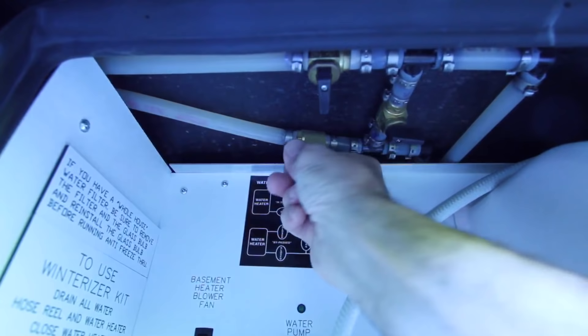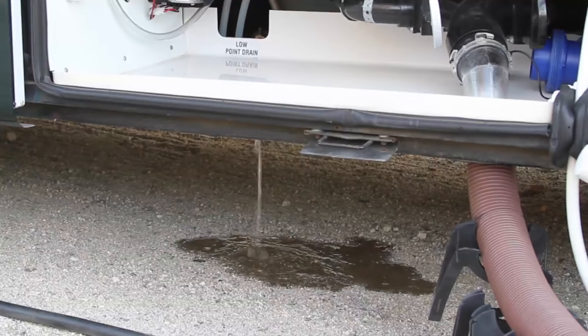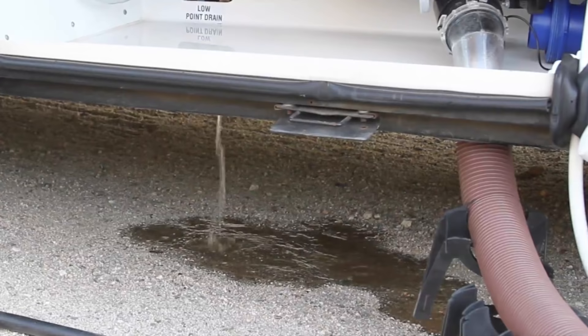Don't forget to switch your water heater bypass valves back to their normal settings for everyday use, and do the same thing with the drinking water filter bypass under your kitchen counter. To avoid wasting water, don't sanitize your tank more often than necessary. We're actually very water conscious, using a small fraction of what a normal household would use — a hundred gallons of water can easily last us ten days or more. But twice a year, we need to use some extra water to keep our onboard supply safe to drink.